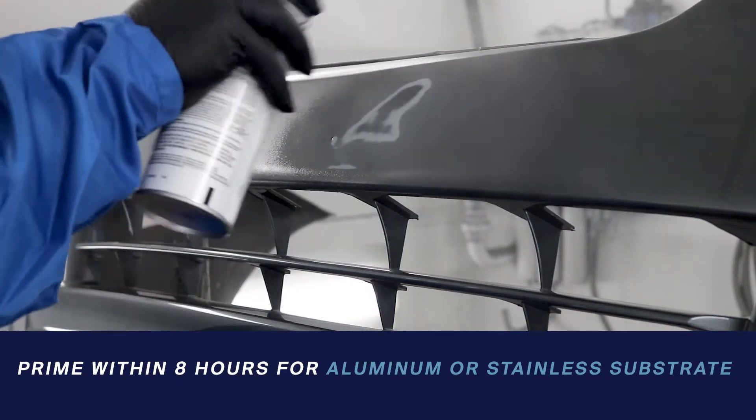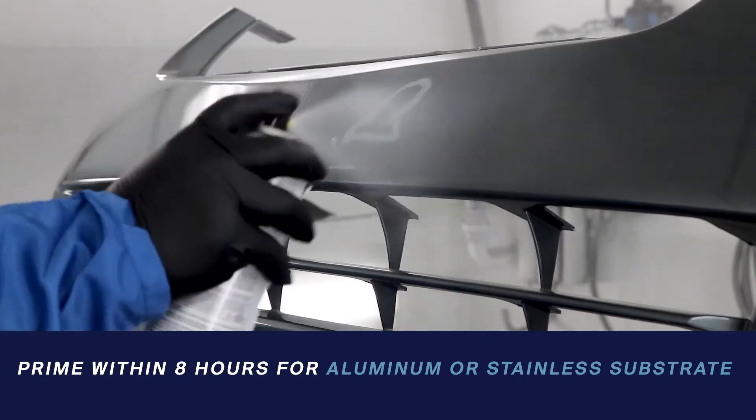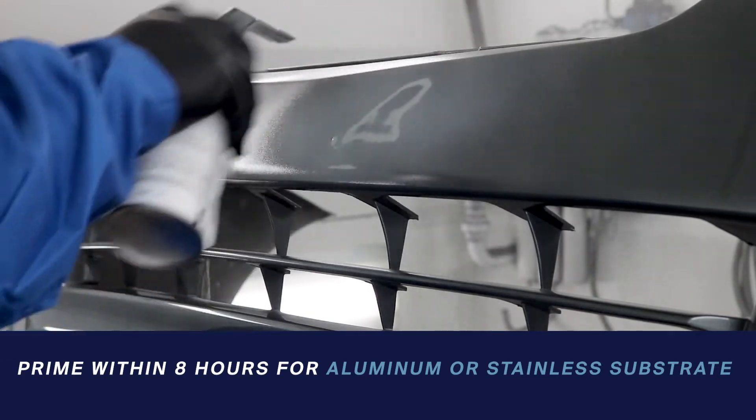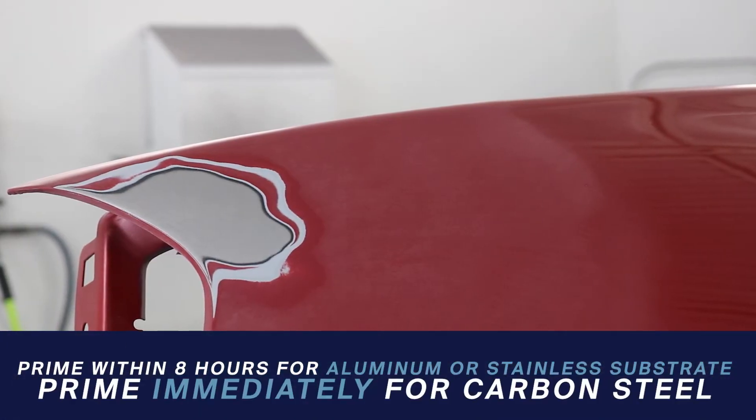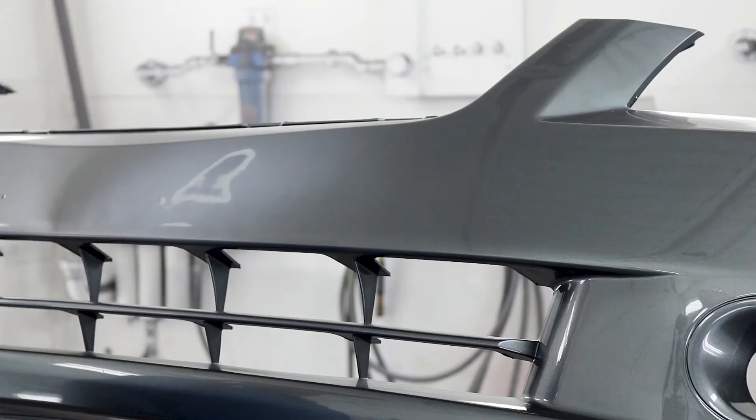ADDPRO SUA-470LV or SU-470LV needs to be applied prior to application of UV primer on all raw exposed plastic areas. For carbon steel, you'll need to prime immediately after prep to get best results. You'll optimize your results even further if you keep repair projects to roughly a six-inch circle or less.